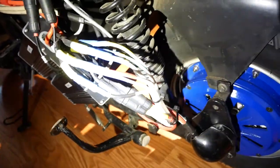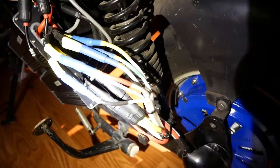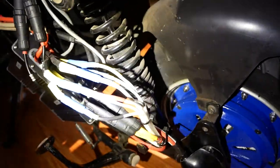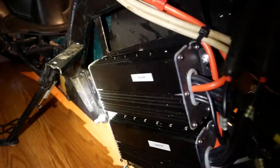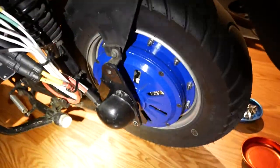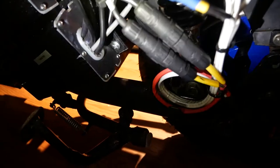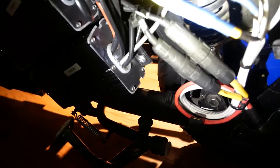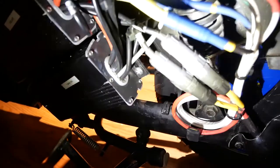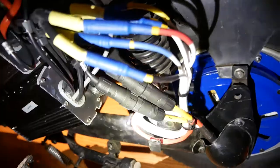I had to put my flashlight in my mouth, but you will see those colored pieces of heat shrink on all the wires. Black, red, and white go to the slave controllers — that's the top one. Each one of them is essentially running half the motor. The hall wires come out into those two IP68 6-pin connectors, of which there is a temp sensor and of course the three halls. That's splitting things up.